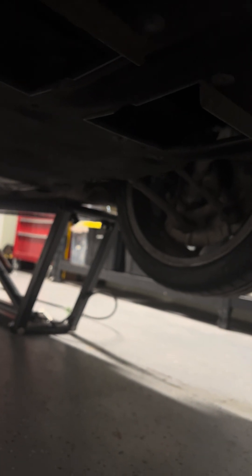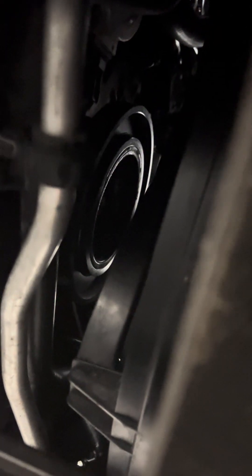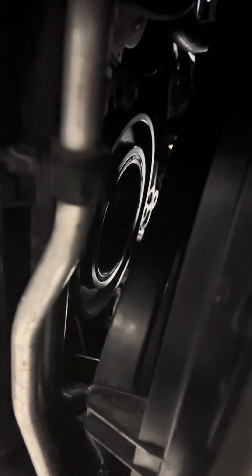From the bottom, I dropped the underbody panels and was able to push the fan assembly up about four inches. With that, I had all the access I needed to reach the harmonic balancer down here and torque those bolts and the crank guard bolts just fine. I would have preferred starting from the beginning this way, because it would have made it a lot easier to break those bolts free than trying to fit a hand in between the fan assembly and the balancer.